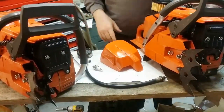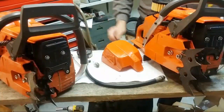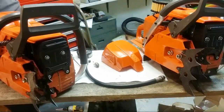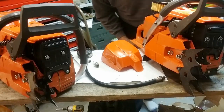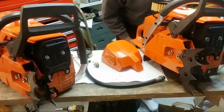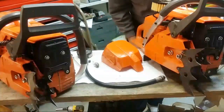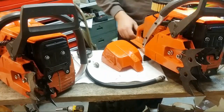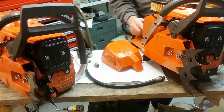Neither of these have squish bands cut, but I'm pretty sure I decked the cases and everything. So again, you can go back and look. Let's look in there. We need a light. Yeah, I got tree stumps on Sunday. I tell you what, this one feels like it's got a lot more than 170 behind it. When you try to crank it, holy cow. It definitely feels like it's got a lot more than 170 pounds.